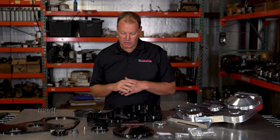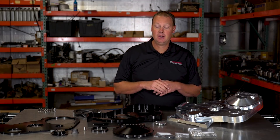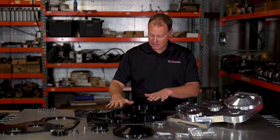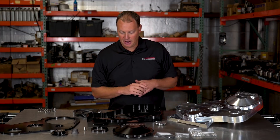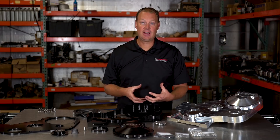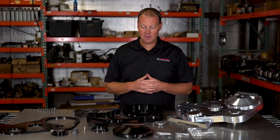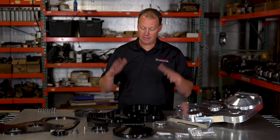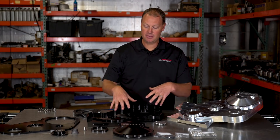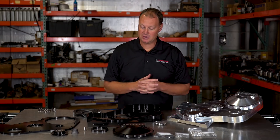Another thing I wanted to address: one time I had to swap a pump. When you take a pump off, the gear stays in your gear case. When I put a new pump in, it was different — I couldn't use my adjustable gear to get it right. I had to move a few teeth of the gear on the cam, which meant pulling off the cover, and you can't pull off the cover without pulling off the dampener. So off the dampener comes, off the cover comes — at a race. It took a lot of time.